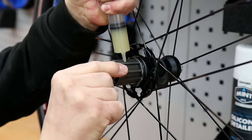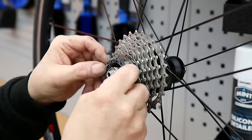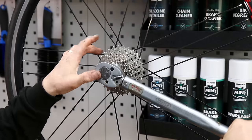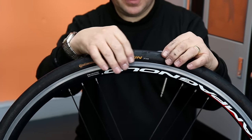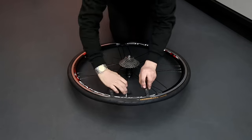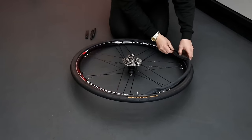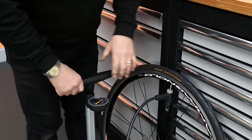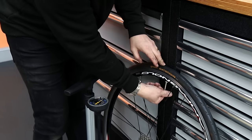Next up I'm going to wash the back wheel — this actually had quite a film of oil on the rim. We had to work at that quite a bit off camera as well as on camera, and you can see how clean that hub is now. A little bit of general purpose grease before the cassette goes on will stop any corrosion forming and help it come on and off for cleaning. The last thing I want to do with this wheel is move the tire logo to center over the valve — it helps you locate a puncture, looks aesthetically pleasing, and matches it to the front wheel. So we inflate that, on goes the valve cap, and we're ready to refit.